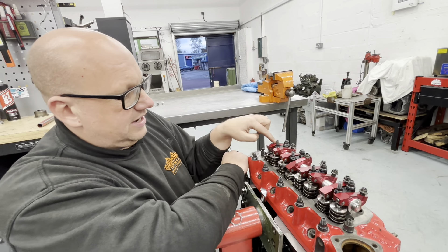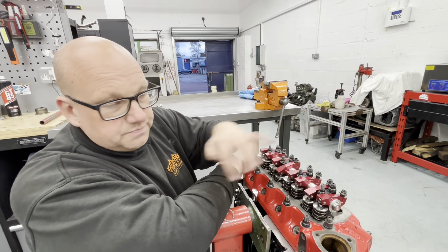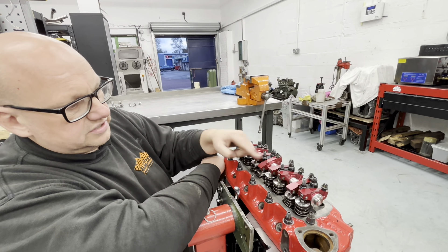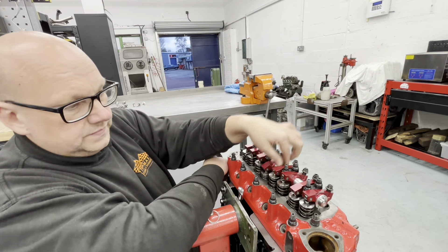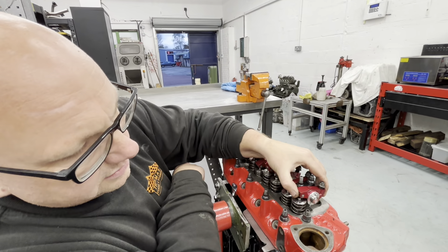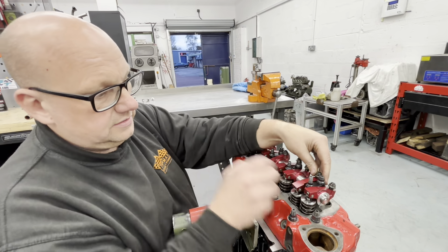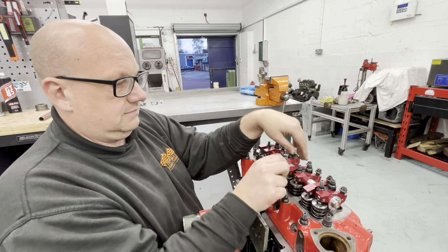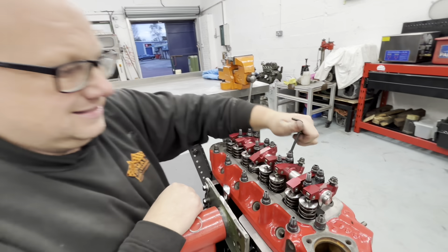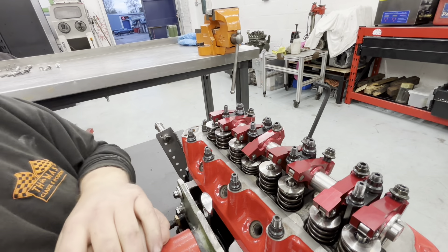So what I'm going to have to do now is take this assembly off here, fully strip it, and I'm going to need to machine something off these spacers to get us some clearance. The others look fine, but I dare say as soon as I start rolling this over and doing the tappets, if it's happening on these two, it's probably going to happen on these two as well. It won't happen on the end ones because those do have some lateral movement sideways. But certainly these ones have no movement. Just look how tight that is — just imagine the drag and the load that's going to put on your valve train.